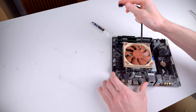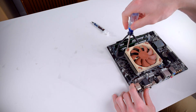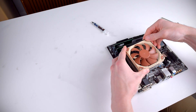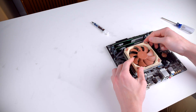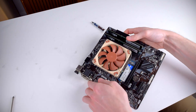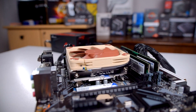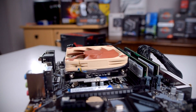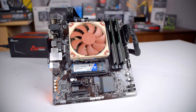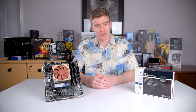After that, just plug in the fan to your motherboard's CPU fan header and it's good to go. If you want to keep the fan cable really tidy, you can unscrew the fan from the heatsink and rotate it so the cable stays nicely wrapped along the fan's chassis. With it installed that way, this is a very clean look, and the L9i is just barely taller than standard height RAM, so it will fit into extremely slim cases. All in all, this is one of the easiest installation processes of any aftermarket CPU cooler I've ever tested. Very nice work, Noctua.